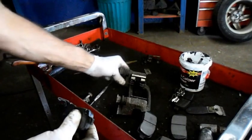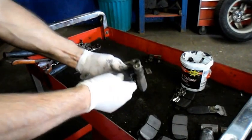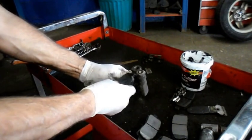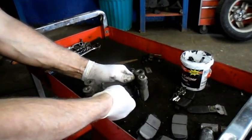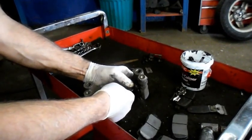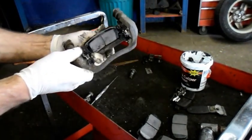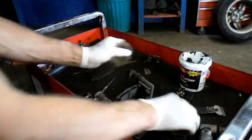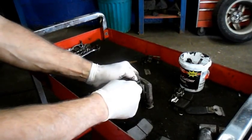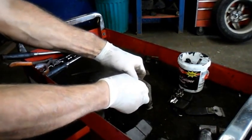And remember what I told you about that caliper — see these little pins right here? That's why I said you should have that caliper facing straight from back to front because this pin has to fit into that caliper. So this one now goes inside here like this, push it in — it's a little tight because it keeps you from rattling around, but you lubricated everything so it should slide nice and freely. I find it easier doing the inner pad here than later on when it's in there. If you want, you can do the outer one too — put it on like this, slide it into its position like that.